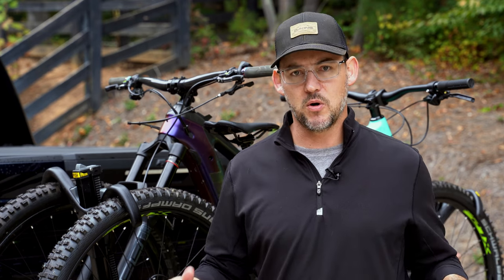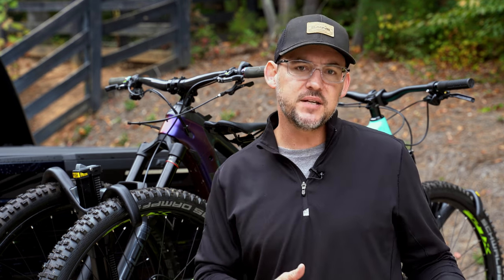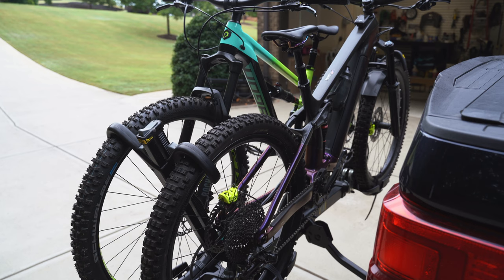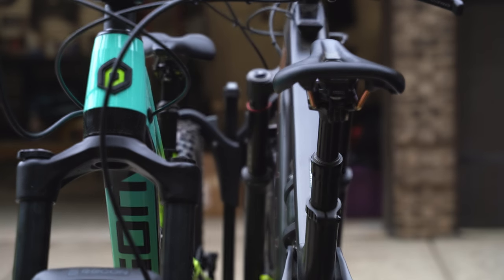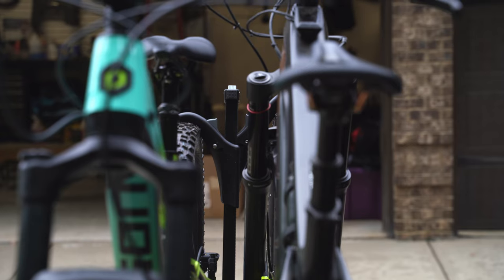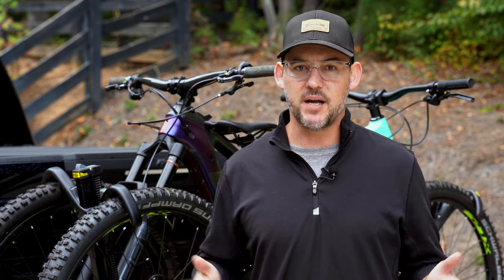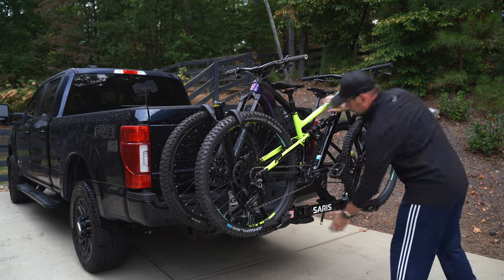Kind of on the same point — because this is such a low-profile rack using only one bar, when you flip it up into storage mode you're not really saving that much room. It would have been nice to see a pivot point a little bit farther back so you can get the rack closer to the back of your vehicle when in storage position. And because this is a one-bar setup, the bikes are pretty close together. You've got to be really careful about clearances, especially with bikes of different sizes. It does help to have dropper posts so you can get the handlebars out of the way, but just keep in mind you might have to do a little more adjusting than you would on a dual-tray setup.